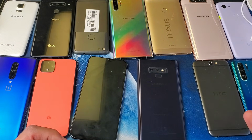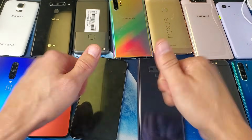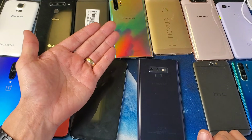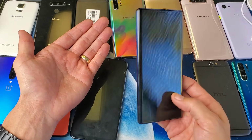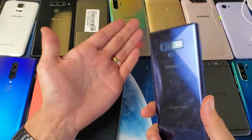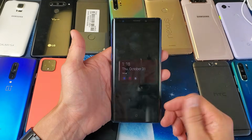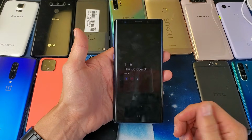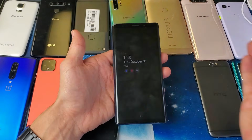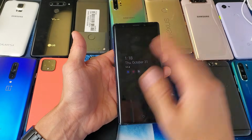Step number 7 is similar to the double finger tapping. Also very similar to the thumb pressing, except this time we're going to do what I call the smack method. Go ahead and grab your phone here. And remember, it's very possible it's a loose connection, okay? Like I said, 70% of the time, you guys think that you have a bad screen and you bring it to a repair shop, and the only thing they had to do was basically do the thumb press or one of these easy methods I have here in the video, rather than replacing your entire LCD screen.